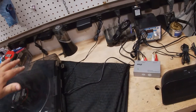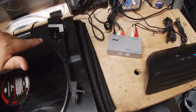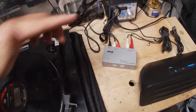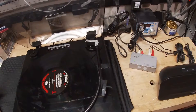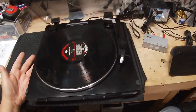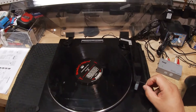The ground wire is basically screwed on to the harness that's holding the mechanism of the turntable. The one thing I could not fix is the dampening — when cueing, the cartridge just drops a little too hard. I tried adjusting it with a screw to make the tracking lighter, but it didn't help. I think my main purpose was to show you guys how to wire a power supply onto this turntable, which I've managed to do successfully. So instead of using the automatic feature, I'm just going to manually place the needle so it doesn't drop too hard.